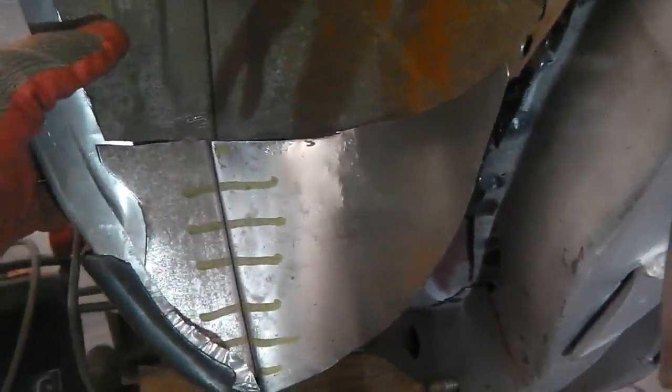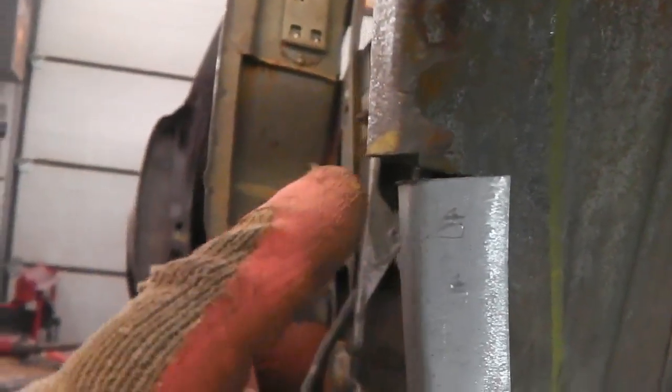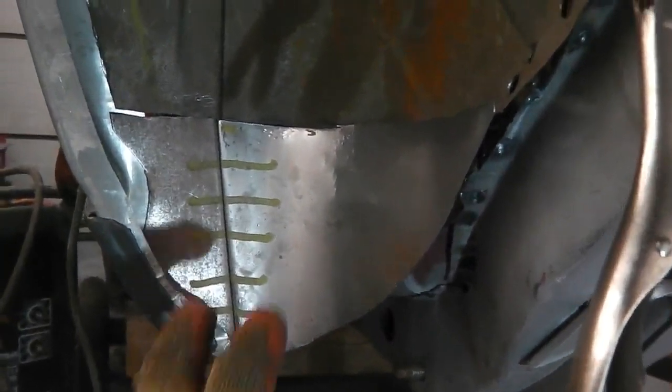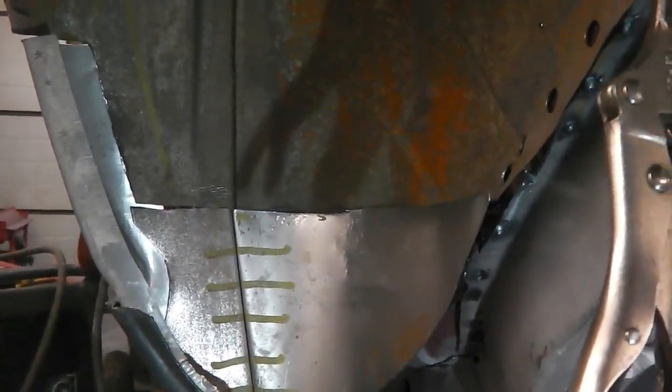So that tub goes across to the right. Look, you pull that, and that seam join line's exactly up. So I've undercut this. I've made a mistake at the top. I'll have to put an infill piece at the back of it to get that. So one mistake, but considering it's a bit of an intersection of panels, I think it's going to look quite good. We've got a hole to put in it, an inspection hole gets drilled in there as well. All in all, I'm very pleased with how this is going so far.